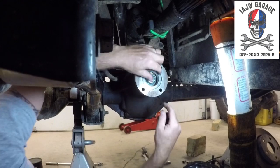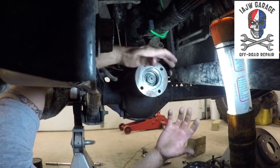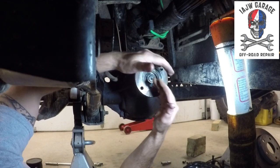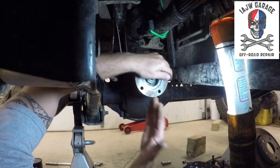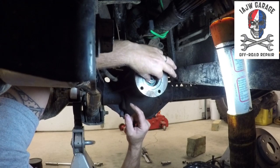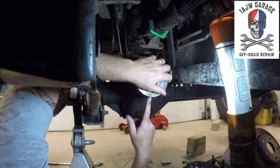You can't take it back off. You can't loosen it. It doesn't work that way because you crushed the sleeve. If you loosen it now, it will be loose. You'll have play. So that's why when you get it close, you just move it a little bit, take everything apart, and measure. You move it a little bit, take everything apart, and measure. I had 6 inch pounds. I moved the nut maybe a 32nd, maybe nothing. It seemed like nothing, and I increased it almost 10 inch pounds.